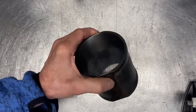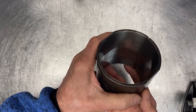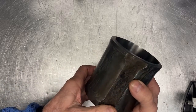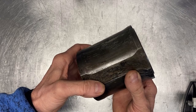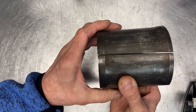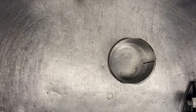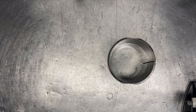This is the tool I'm using to install the pistons — it's just an old piston liner. I made a taper in it so when you push down the pistons the rings get compressed, and a 45-degree sharp ridge that fits in the chamfered edge of the bores. I also made a cut down the liner which puts some tension in it so it shrinks slightly and the diameter gets a little smaller. The downside was that the new pistons weren't going down smoothly, so I had to resort to tapping them down because of some friction.